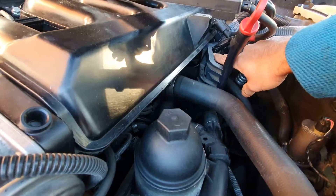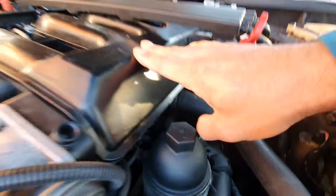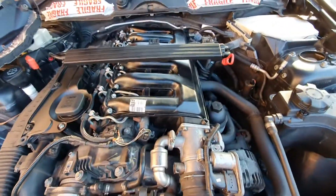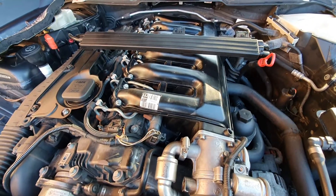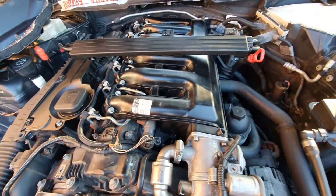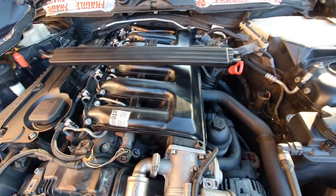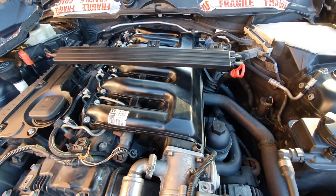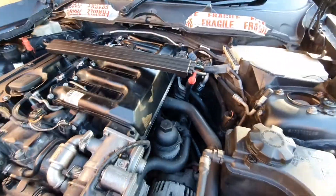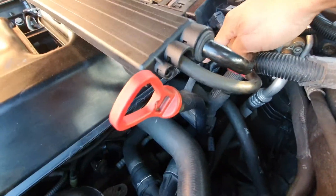If you come across this error, first thing to check is that sensor cable — make sure it's plugged in. You can very easily get carried away when putting the inlet manifold back on given the level of work involved, and also stay focused because you risk dropping things through the hole on the cylinder head. It's easy to make mistakes, so make sure you check those cables are plugged in and you should be fine.